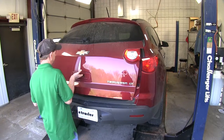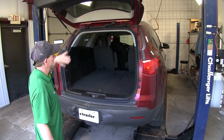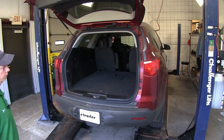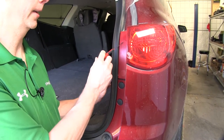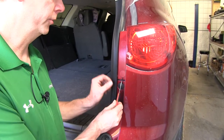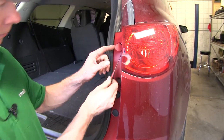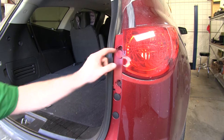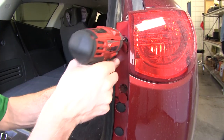Okay, let's go ahead and install the wiring harness. It's relatively simple. First off we need to go ahead and open the back hatch, then go ahead and start removing the taillights. The hardware to remove a taillight is going to be behind these two little covers here. It pops loose with a little flat blade screwdriver. We'll go ahead and remove the screws inside using a seven millimeter socket.